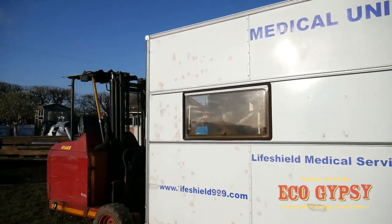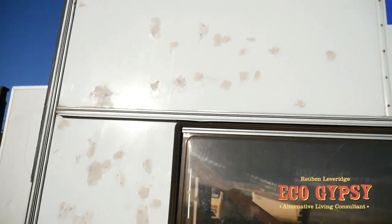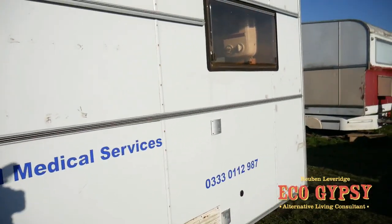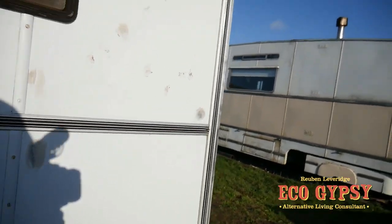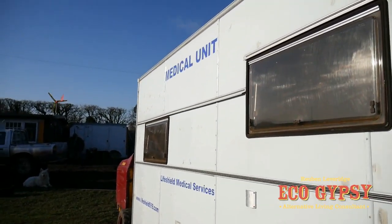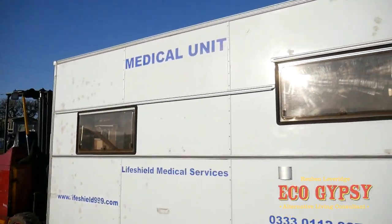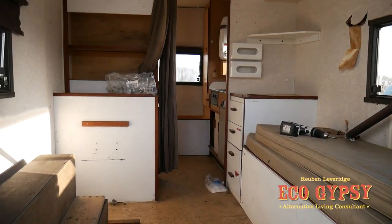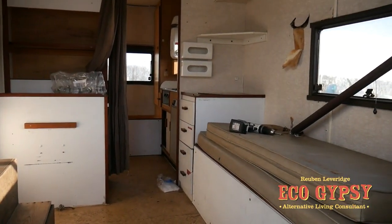We've gone around and as you can see we've filled all of these pinpricks in. We've also done things like the reflectors on the back and sides - we've took them off. So all these things will help with damp problems. It's all been filled up all the way round, we've sealed the roof and sealed the skylights. Now we're going to have a little look inside. Everything up to that bulkhead has got to come out so we can get the wheel arches in, the bed in and all the rest of it.